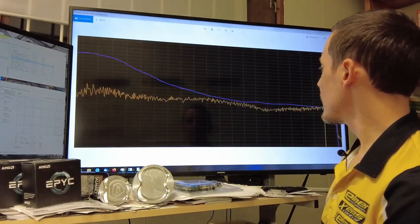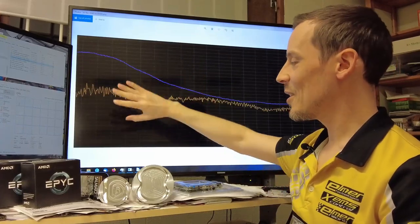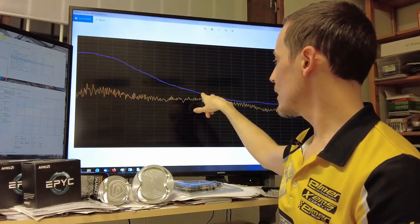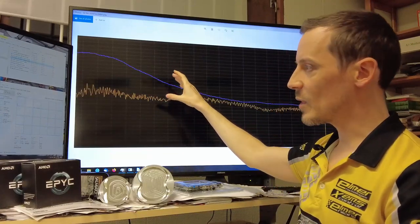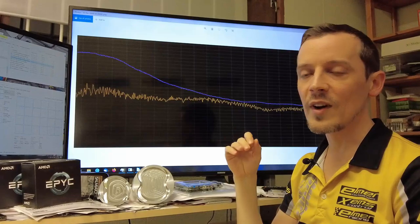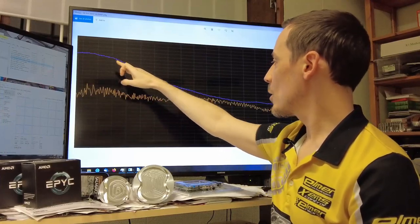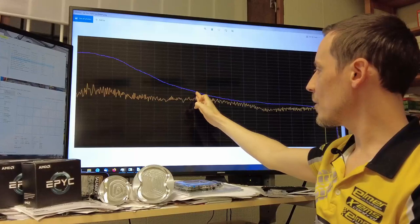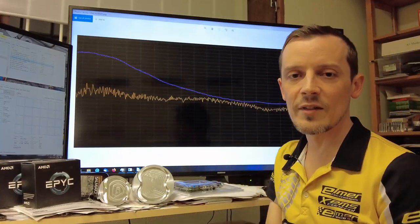Let's look at the inlet and exhaust manifold pressures from our Rex engine — heavily censored, no absolute numbers. The inlet pressure is this purple line and the exhaust pressure here. The inlet pressure is smooth because it's an ECU input value; the exhaust pressure is a raw input. This is a ramp run from the chassis dyno — lower RPM here, higher RPM here. We're reaching the choke limit on the inlet restrictor around these points, and you can see we're maintaining a positive pressure ratio basically even at the limit of the inlet restrictor.